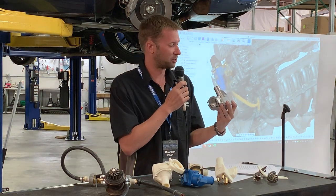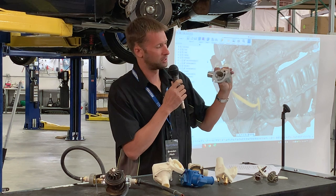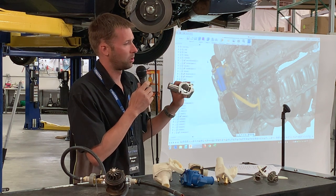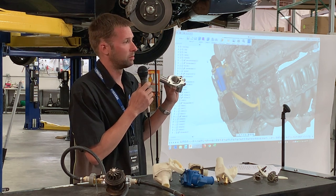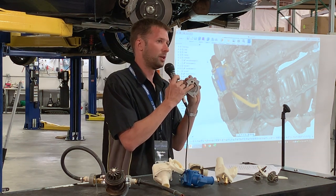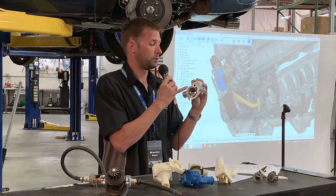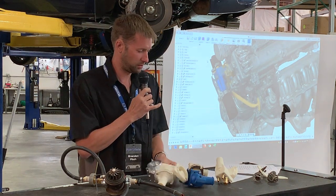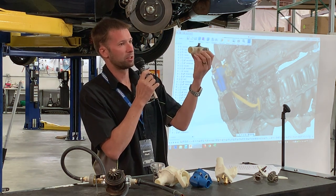And this one was going to be slotted for a long time, but part of the problem, and I'm digressing slightly here, is that the ECU has to see pre-thermostat water. If it sees post-thermostat water, it's frequently not an accurate representation of the temperature in the engine. So with this cavity right here, getting coolant to the ECU temp sensor prior to the thermostat was a challenge. But we got it figured out. Over here, it was really ugly, but you can see that the cavity is on the top. That makes more sense, right?